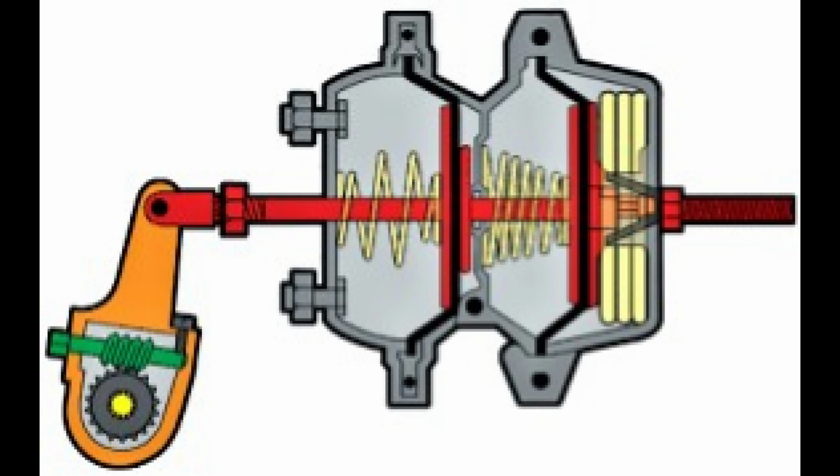Parking brakes on air brake equipped trucks are often referred to as spring brakes because they're applied with a large powerful spring and released by admitting air into the brake chamber to compress the spring. Parking brakes can be released manually using what's called a caging bolt, and this illustration does show a caging bolt in place holding the spring brake compressed.